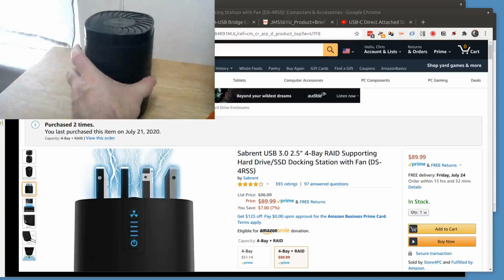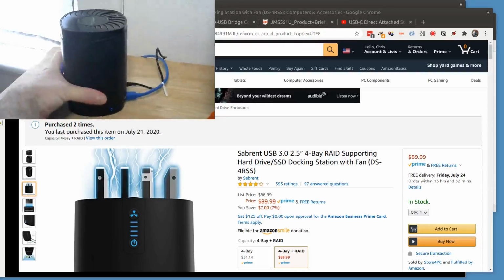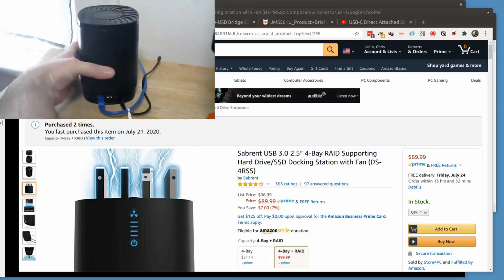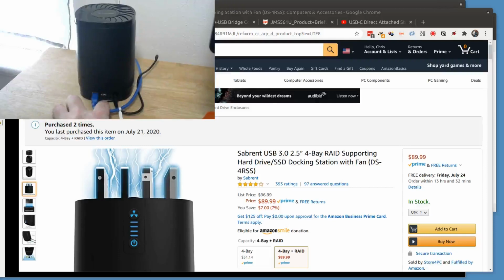On the back of the thing, if I can turn it around, it's rebuilding right now, which is why I'm a little leery of the thing. On the back we have these dip switches. This is set up to RAID 5. Then there's this little recessed button down here that you press when you want to reset the RAID configuration or unset the RAID configuration. Be careful when you do that if you have drives in there that are already part of a RAID configuration, because they'll be wiped, more or less. I'm not sure they'll be wiped, but the drive will consider them part of a new array and will zero out whatever it uses to keep track of the RAID status.